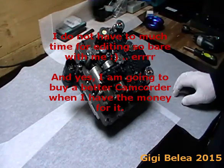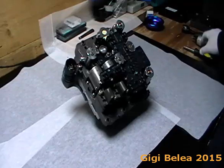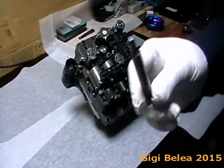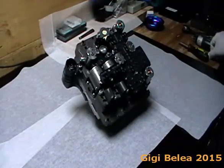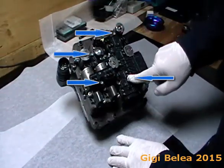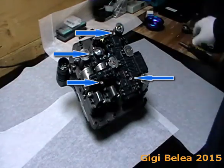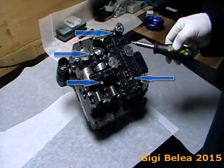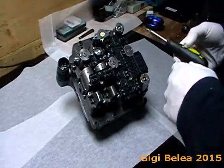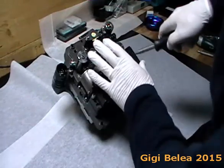I am wearing gloves now. What you will need is a screwdriver with a T20 bit and a slightly bigger T30 bit — that's all you need to dismantle it. First we have four screws here — one, two, three and four — that are holding the plastic interconnector.